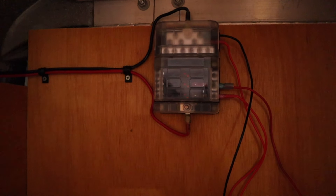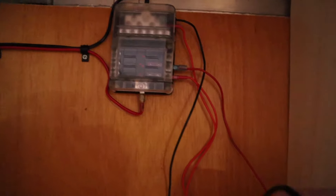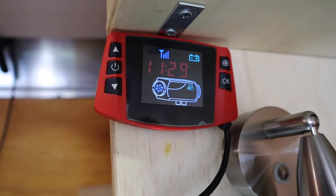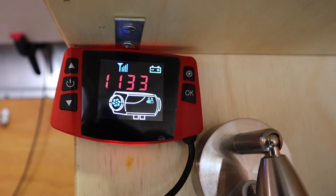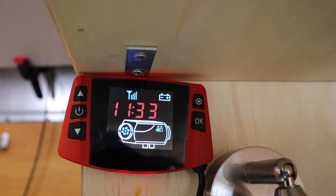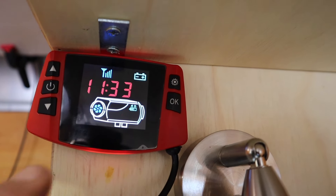This thing is pretty much installed. There's a wiring harness with positive and negative leads and a place to plug in the controller module. I have the positive and negative leads going to my fuse block, and then the wire for the control panel is fed up and clumped with these wires, coming over to where I have my control panel mounted.